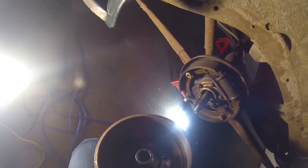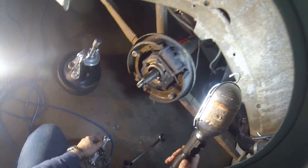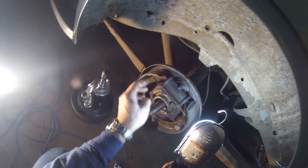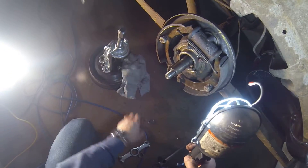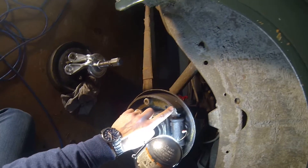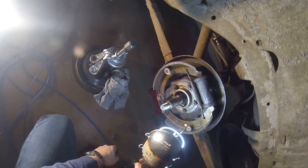Here it is - drum's out. Drum looks good too. Another old set of brakes that are clean - no leakage here, that's a good sign. Just for fun, I wonder how far out of adjustment these are. They look better to me - I see kind of consistent wear all the way around, but worn a bit more down here. They're out of adjustment.